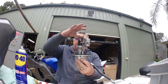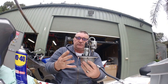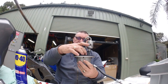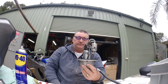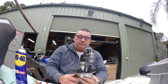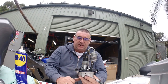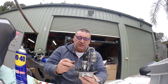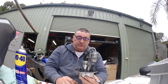because these sit basically in the bottom of the fuel tank like that, with the tank going over here. So when you've got the last little bit of fuel, you know, I've got 10 k's to go before I'm going to run out, well, the fuel's actually sitting in here, in this little bit. So no matter how much fuel you've got on your bike, when you leave them sit for such a long time, it's in there doing that. And basically it just clogs up the pump, and if you've ever seen old fuel, it goes like a brown clay, and pretty much that's what had happened.